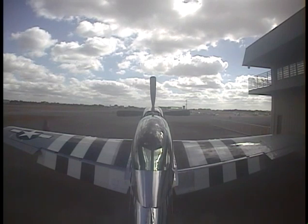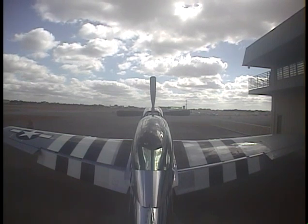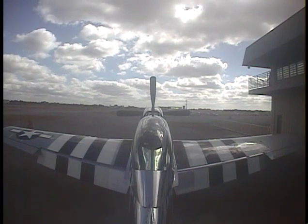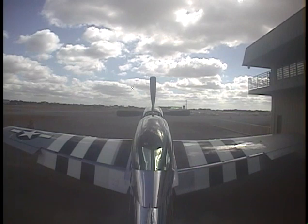Each wing tank has its own electric boost pump to back up the engine driven boost pump. So we're going to go to the right boost pump. If you look at that fuel gauge above your right knee, you see it's about 12, so that's good. We're actually going to take off on the left tank. So left tank selected, detent triangle, pressure's good. Mechanical gauges in the floor, so 90 gallons left side cap's on no venting. 90 gallons right side cap is on no venting.